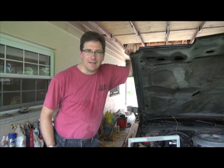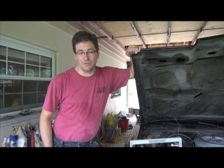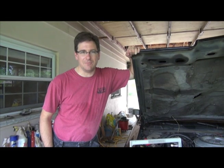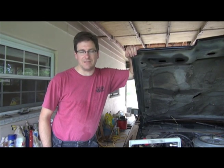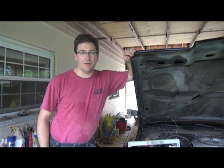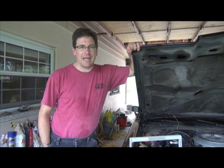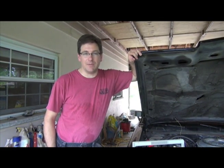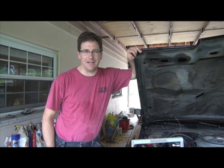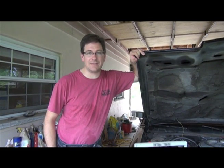This is my beloved 1982 Lincoln Continental Mark VI, which uses the Ford EEC-3 electronic engine controls. These are very controversial because some people really hate them — the EEC-3 system does not give you a diagnostic test connector where you can read the codes very easily, as you can on the later EEC-4, 5, and 6 systems. But there is a way to get the codes out of the car. You'll find instructions on the internet, but it's a little tricky and complicated because there's some conflicting information out there. I've got this set up because I've got a little drivability problem — some hesitation and rough idle — and I'm going to pull the codes on this car from the EEC-3 system. I figured while we had the whole thing set up, we'd show you how to do it.